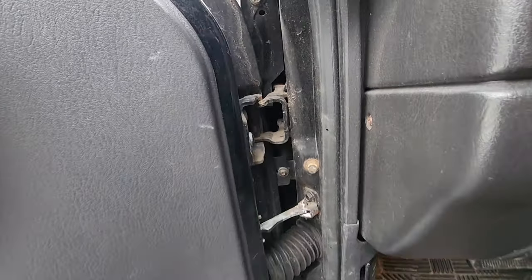Hey, look at that. An O2 sensor, bank 2, sensor 2. This thing again. That's exactly what I thought it was from last time. I do believe we got a bad wire in there, just tapping around and messing things up. So we'll check that out. Let's see if we can go back.